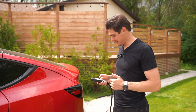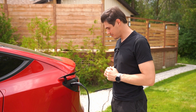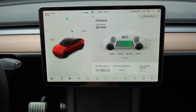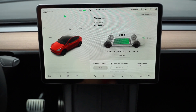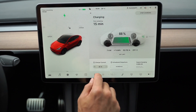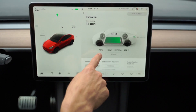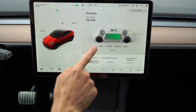Let's test it out and see the magic. Looks like we got the juice! This Tesla Model Y, made on March 8, 2021, is currently set to the maximum for Level 2 home charging — 32 amps, which is 80 percent of the constant load on a 40 amp breaker. As you can see it's charging at 7 to 8 kilowatts per hour, jumping up to 8, and in my previous experience it usually stays at 8 kilowatts per hour.